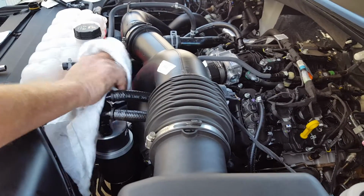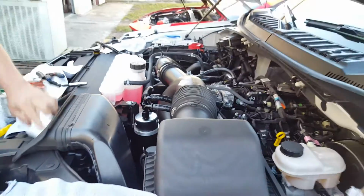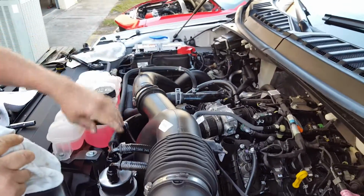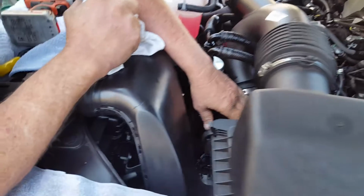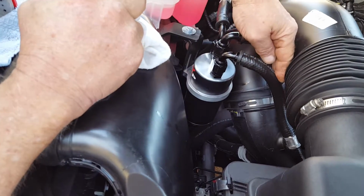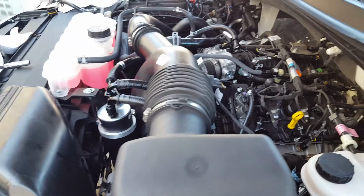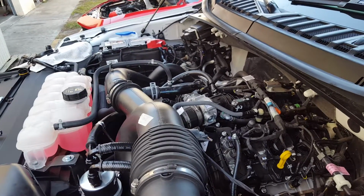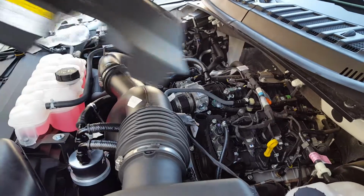And we have the intake manifold vacuum providing idle and deceleration evacuation. Venturi effect, turbo inlet, suction for in-boost evacuation. Now that we're this far, we're going to reinstall the engine cover. And we're going to finish off the clean side separator.